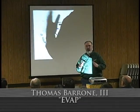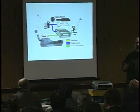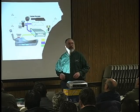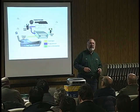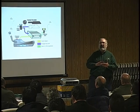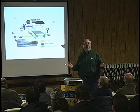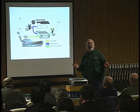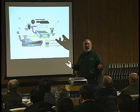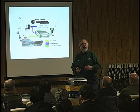happened to the computer. I also own a shop in Middletown, and one of the guys was doing an oil change on an old '85 Chevy Impala. But he takes out the drain plug and brings it up to me and says, you know, there's something wrong with this drain plug. The tops of the threads were all stripped out. I said, all right, no problem. I got this, it was a 12 by 1.75 millimeter drain plug. He said, no problem. I got those right in stock. So I went out and got one.